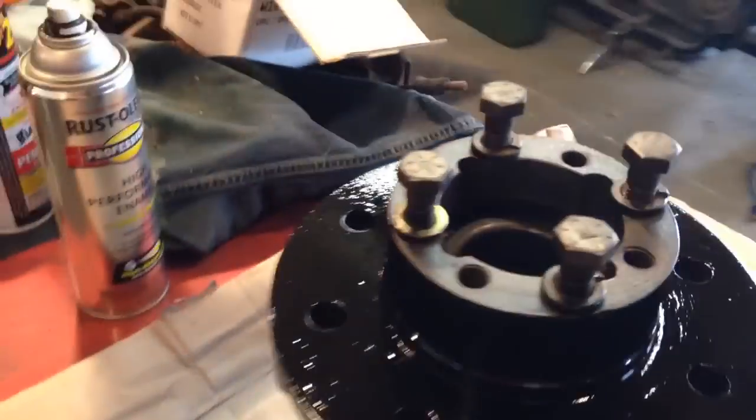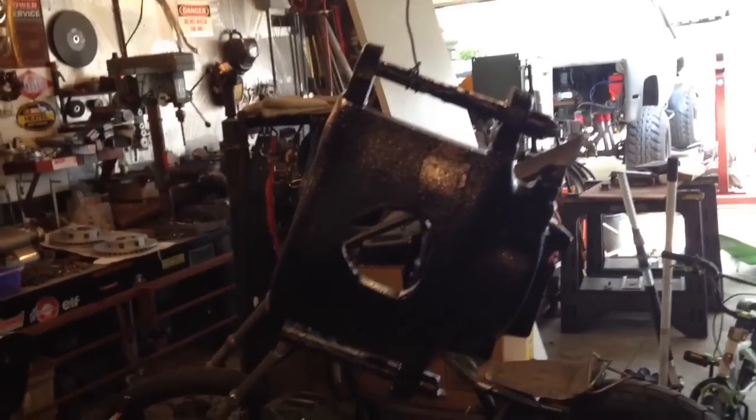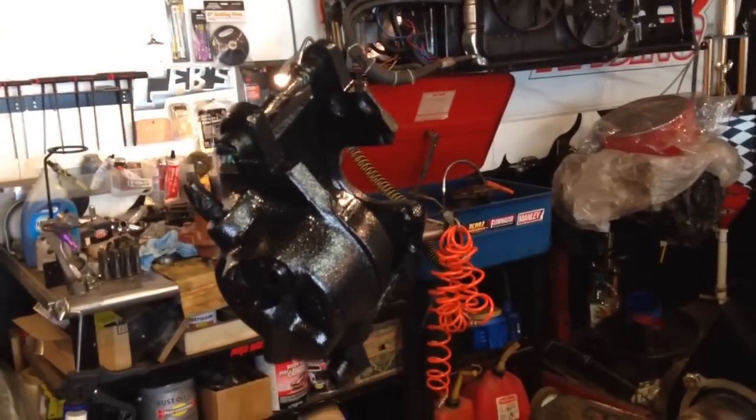It'll rust before long anyway. Hubs are all cleaned up. I brushed some Rust-Oleum rusty metal primer on them and then hit them with some Rust-Oleum gloss black. Remanufactured loaded calipers from AutoZone — I just cleaned those up with lacquer thinner, cleaned the oil they come with off of there, and then sprayed them with Rust-Oleum black. Once this is all dry, I'll put bearings back in the hubs and seals and snap everything back together.